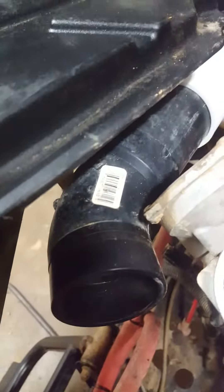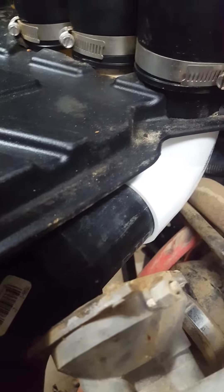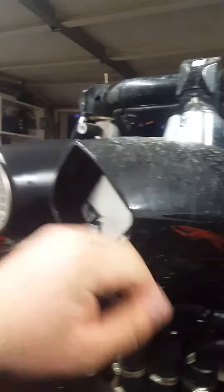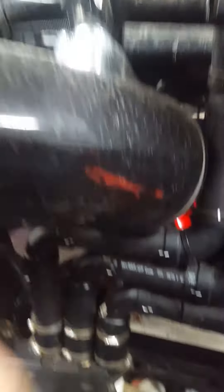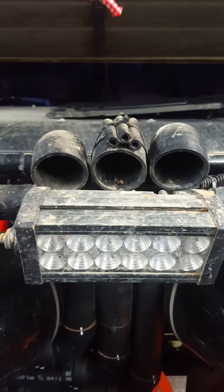Off the air box, I did a two-inch to two-inch rubber coupling to seal that off, then a street 45 to a small section of tubing, to a 90, and then go up. With this build, when we added the cage, he wanted it routed to the center because the speakers right here wouldn't allow me to bring them up and over, so we routed them to the center and up — and they dump out all up there.